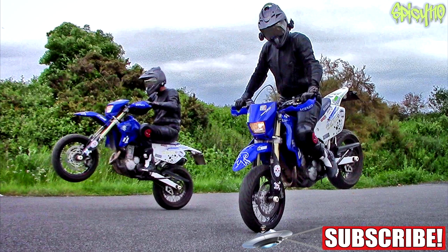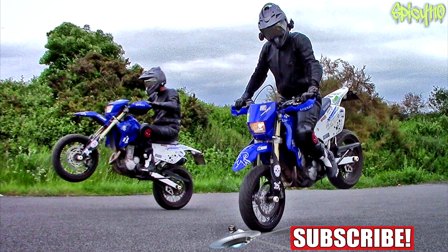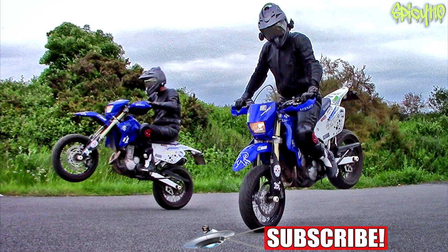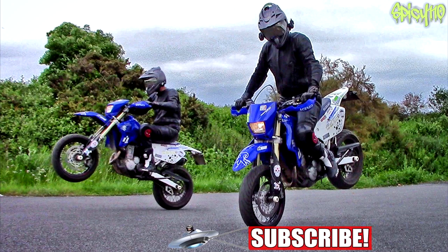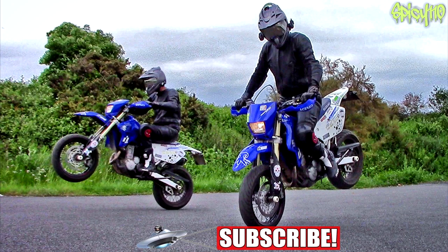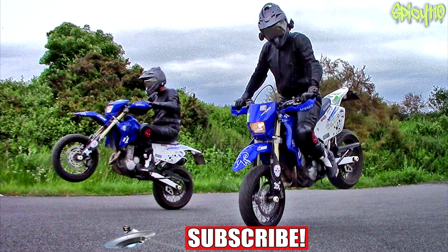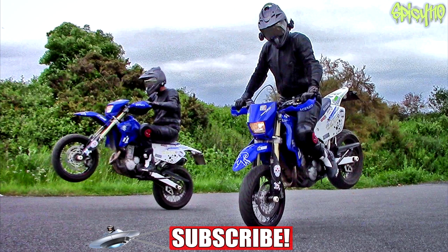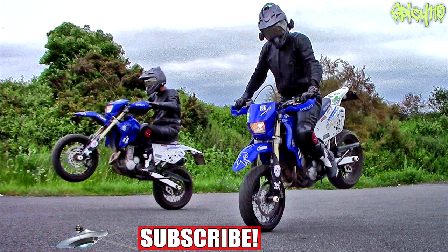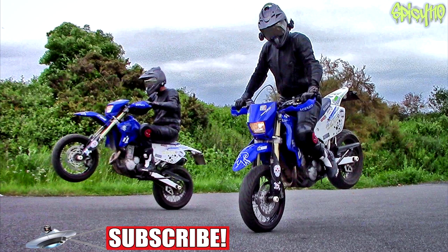Listen to the engine and see if there's any strange knocking. There is a thing about the DRZ — the engines are very mechanically noisy. They make lots of clicking noises, lots of banging noises — it's all a bit noisy to people who are used to an inline four. They're going to say it sounds like it's running like a bag of bolts, but it's not — it's just what it's supposed to sound like. However, if there is a fast continuous tapping, it could be the cam chain. Some years had an automatic cam chain adjuster which didn't adjust properly or over-adjusted. Many people convert to a manual one, like I have, and then you just adjust it as and when needed. I've only actually adjusted mine once, probably by about half a turn — so not a big deal, but it's worth mentioning the manual cam chain adjuster.